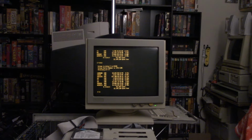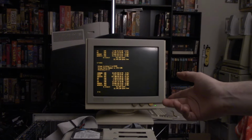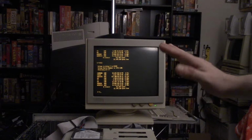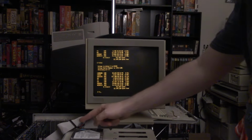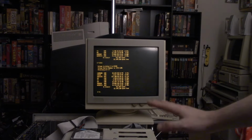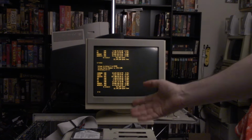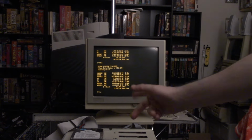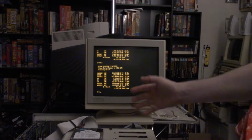I can set the jumpers for, I think, 256 of memory, something along those lines. So if the bad memory is in the second bank, and we're just using the other bank, we should be okay. It's cutting our memory in half, but at least maybe we can have a semi-stable system. So I'm going to give that a try. It should just be one jumper I have to change, and hopefully that works.